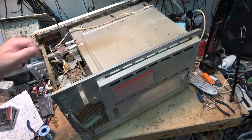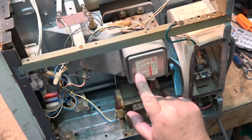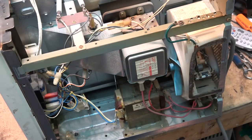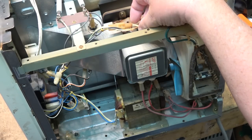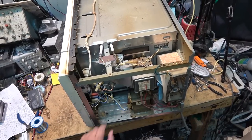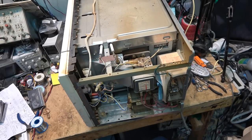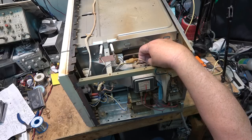There's one of the heating elements there. Look at the magnetron - you can tell this thing's been very well used. This unit's had the magnetron replaced; it came from Main Electronics, got their stamp on here. It's a QPB magnetron, but that's not going to be the issue on this unit - guaranteed - because the person that owns this doesn't use the magnetron. I'm just inspecting to see if there are any wires that are damaged, because these units do get warm and there's always the possibility that insulation will get damaged.